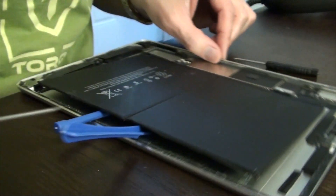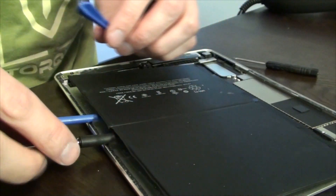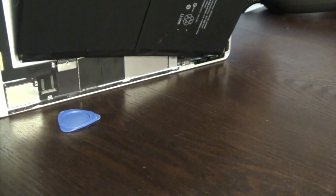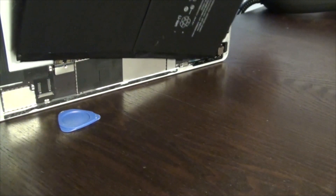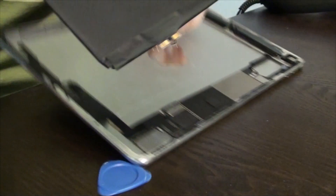At this point, the battery is only loosely attached by that pillar. I'm going to level with you — this is the second hardest part, but I've found it's easiest if you slip a screwdriver underneath the battery and wedge it up and over the top of that pillar.